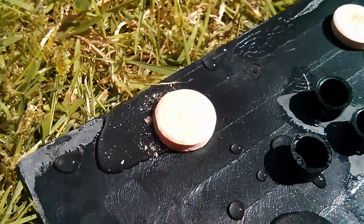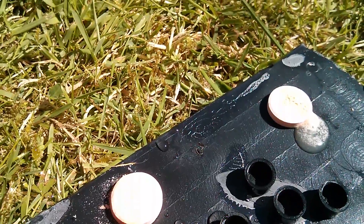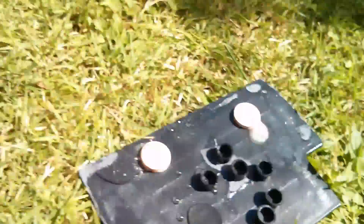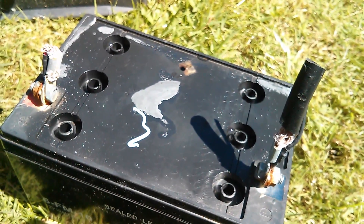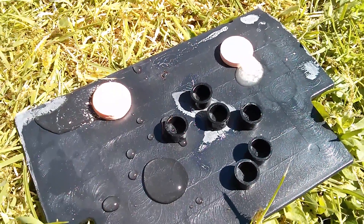Now to test this further, I'm actually going to taste this liquid — I'm going to put it on my finger. I won't taste too much of it, so I'll wipe most of it off. Yep, that's not battery acid. That's water. Rainwater got into this battery — it is a gel battery — it's just water in there. Can't taste anything. So that's not acid, and the calcium carbonate test has proved that.